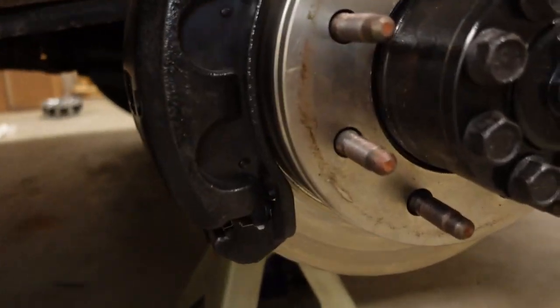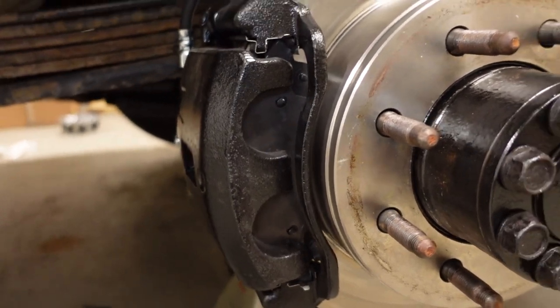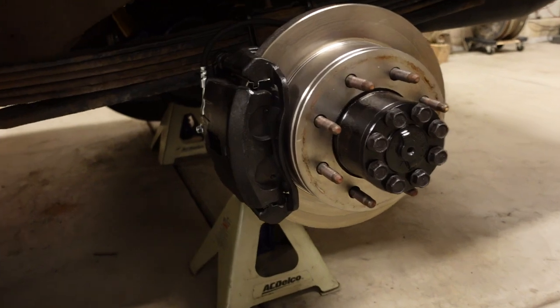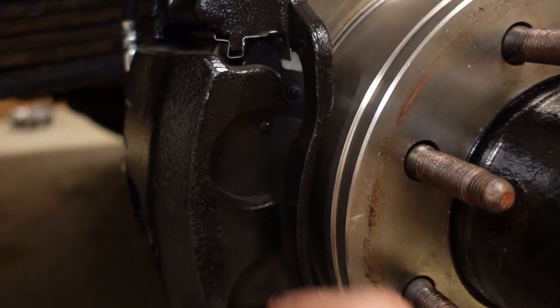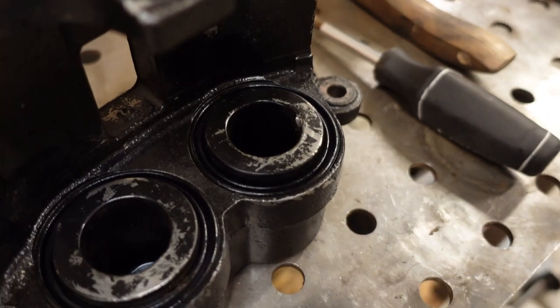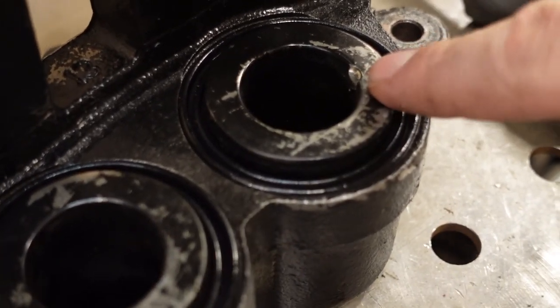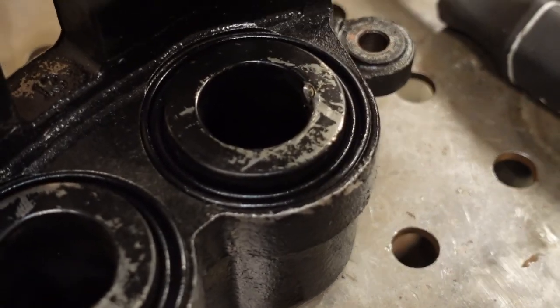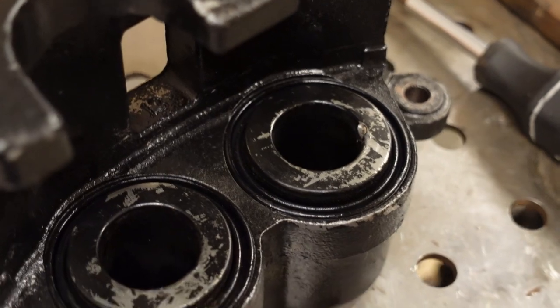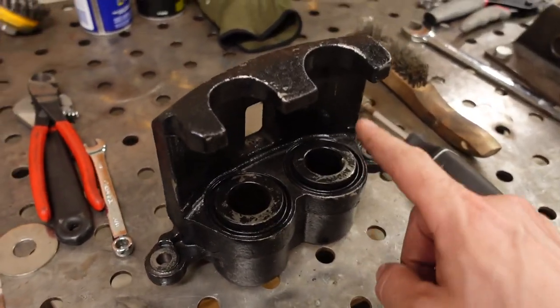There are a couple of little dots on the back of most brake pads to help hold them in place. Just glancing at them, they looked identical, so I didn't think much of it and put them in — and that's when I started bleeding the brakes and realized something was wrong. Those little dots make a really big difference. This is an outside pad — you can see how that dot sits right in the middle of that open spot on the caliper. But I had both inside pads on one side of the truck, so the round piston was hitting right on the edge. I ordered another caliper even though I didn't really need to.